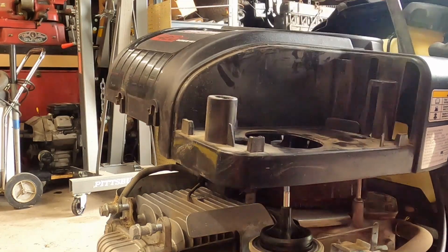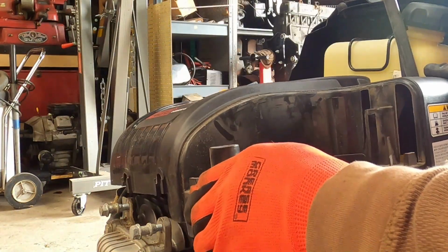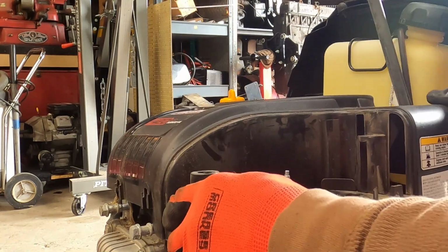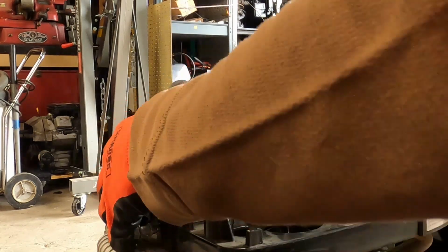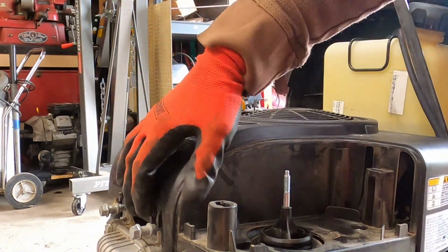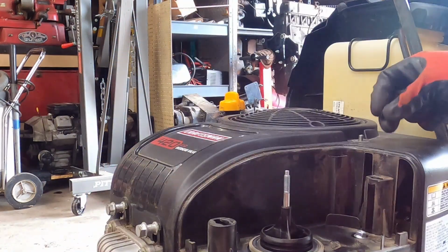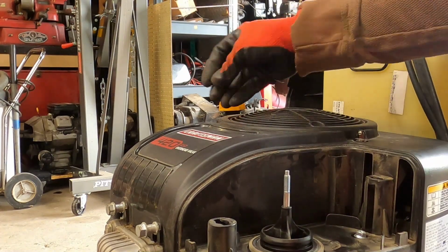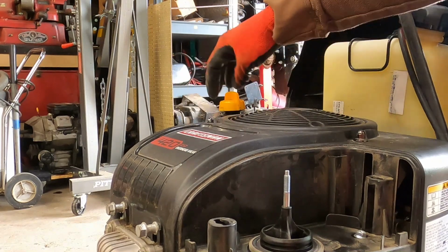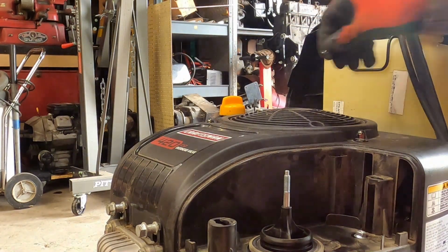so that it's a little easier to finagle it. And you notice I left that bolt in place right there. Just let it drop down. Okay. Then up here, make sure everything settles down into place, and just finger tight everything. You have 3 acorn nuts that go on the top of the blower housing. Get those started. Don't forget to re-secure your oil cap, or you'll have an oil fountain. Been there, done that. Looks cool, makes a heck of a mess.